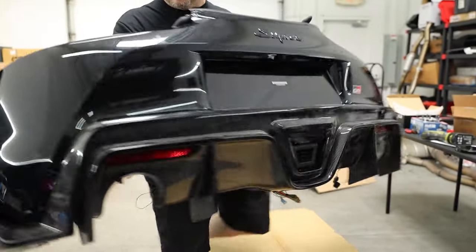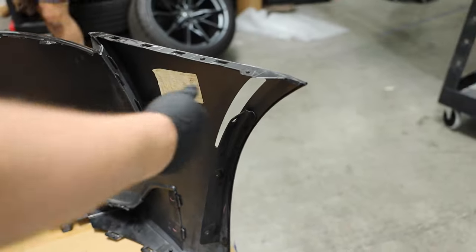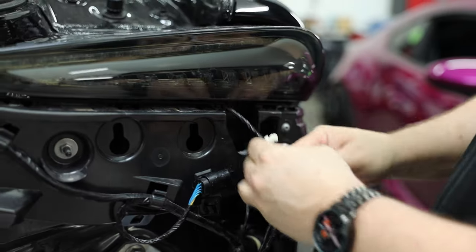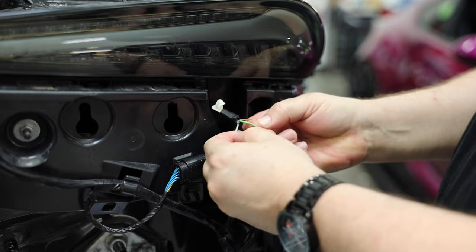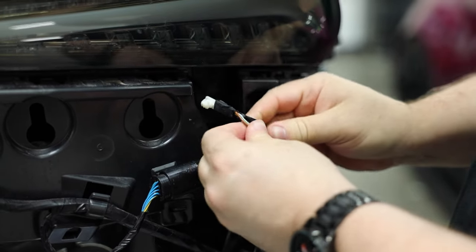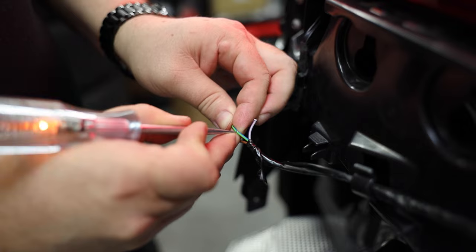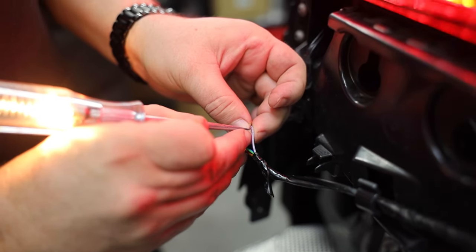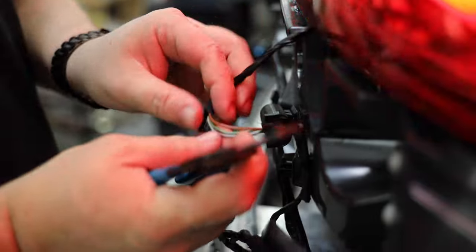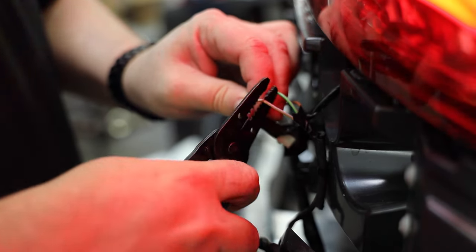We've already installed the fourth brake light. Now we've got to install these LED side marker pieces — we've already removed the inner piece from the light itself. We're gonna tape them in and do all the wiring, then mount the bumper back on. The lights go into the tail light itself, which is much easier with the bumper off. One wire is a ground, one is a parking light, and the other is the brake and turn signal. We're going to tap into the blue with green wire — that's our hazard/turn signal and also our brake wire. The other one is constant — the parking or running light.